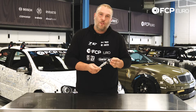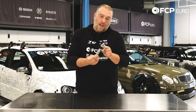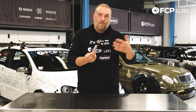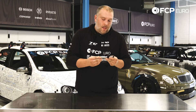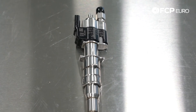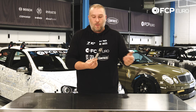The three major issues with these fuel injectors that have occurred over time: first is the internal filter, right here — in the older design, these would actually melt, clog the injector, and for obvious reasons the injector wouldn't work properly. There's also internal leakage, that was another issue. And then there's the piezo stack inside, which becomes out of spec over time — causing these injectors to have really poor response time and really bad fuel delivery.